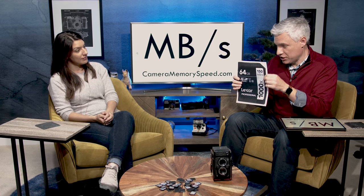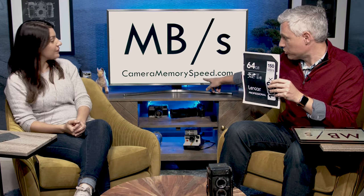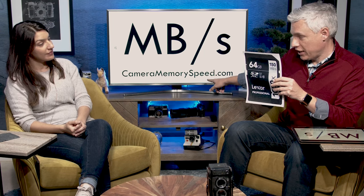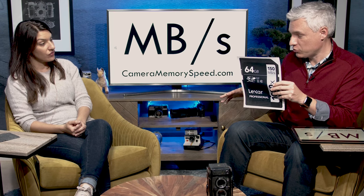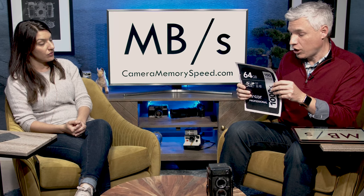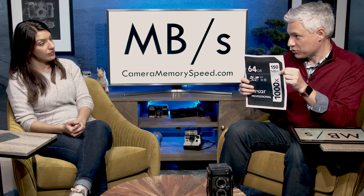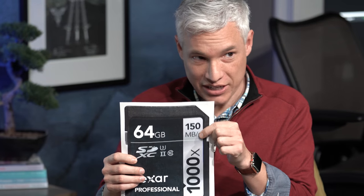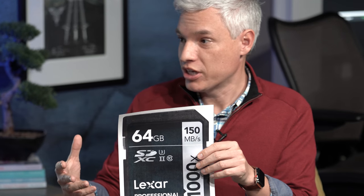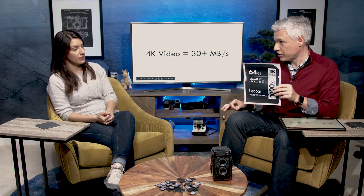But the problem is that this speed that they write on the card is often not the speed that you actually get. You can go to cameramemoryspeed.com. They have a bunch of different actual cards measured with common cameras, so you can see what the actual performance is. But oftentimes, you might get 30 megabytes per second out of this, or 70 megabytes per second out of this. So this speed does not necessarily mean anything because it's very specific to which camera you put it in. If you're trying to shoot 4K video, you want to look for something that's 30 megabytes a second or more.